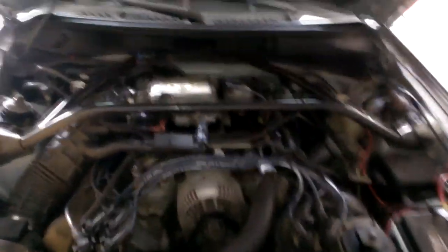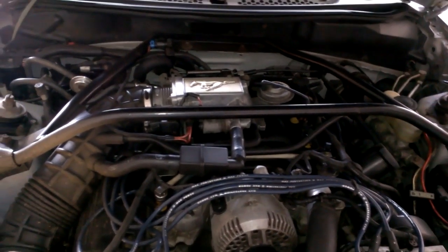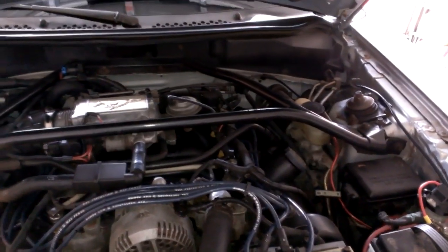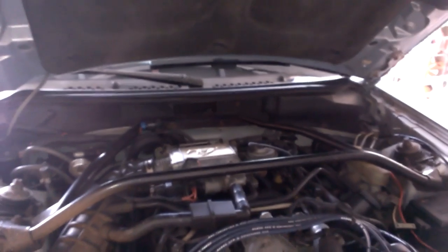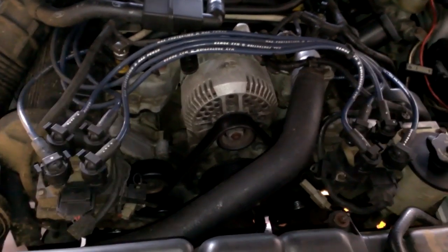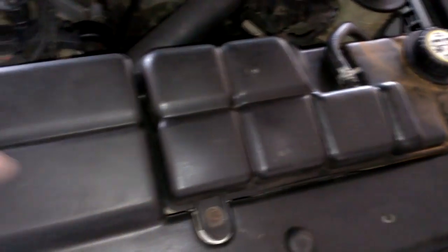This is the engine. I haven't really put any pictures of it — it pretty much looks all stock. It's got a good amount of miles on it and I've got a couple things to fix under there. Right here is where I plan on putting the turbo. I'll relocate the coil pack and cut off this plastic — it's just fake, just to continue the overflow. Then bring the exhaust pipes out front.